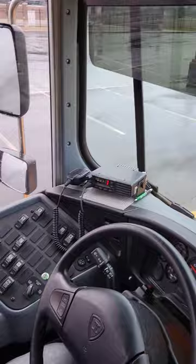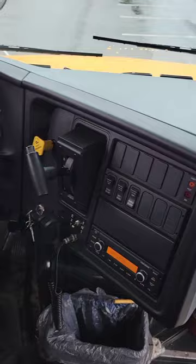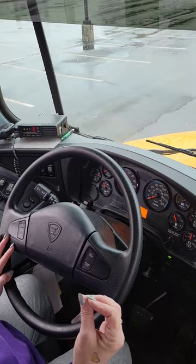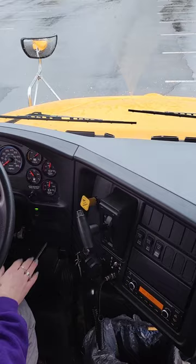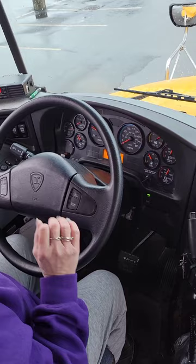My flasher light, which is the amber student warning lights — I'm going to hit that button. My amber student warning lights come on in the dashboard and on the side panel. When I open the door, they change to red, and the stop sign comes out, lights turn red, and the arm comes out. When I close the door, those things cancel. When your light and buzzer go off, you're going to hear the buzzer more than you see the light. My low warning system shut off at 80. Each notch on the gauge is 15 PSI.